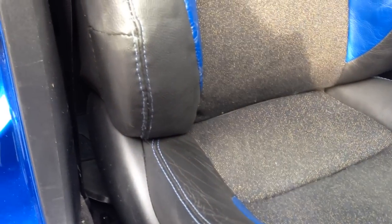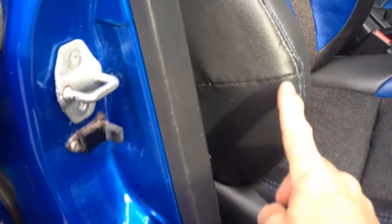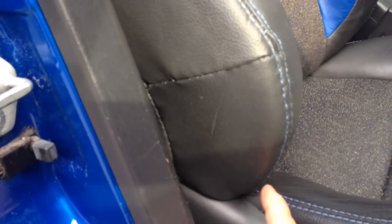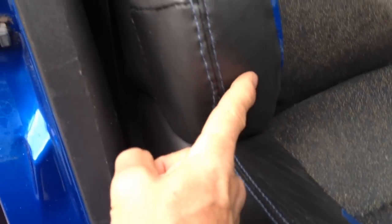So that's the seat refitted and re-stitched — it's the first time of doing this. Not a fantastic job, but better than it was at least. What's been changed is this whole section is a new piece of leather that came from the leather that's actually underneath the seat and stretches this part of the cover round to the back — it's completely invisible, so I borrowed that. I replaced the bottom bit with a piece of leatherette. But it could be anything because you can't actually see it. And this whole section down to the bottom is also a new patch that came from the passenger seat in order to get enough leather.